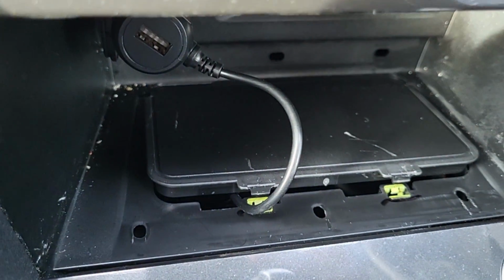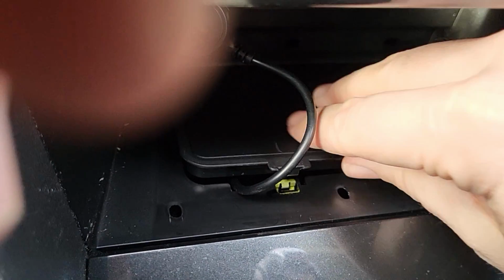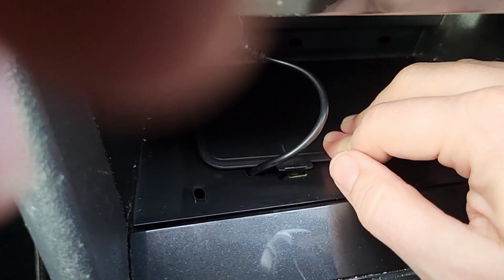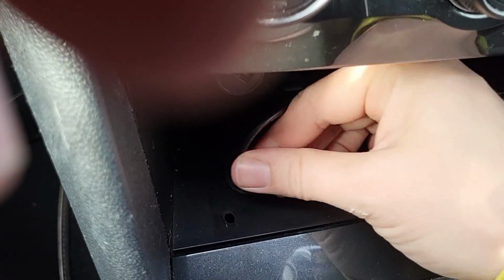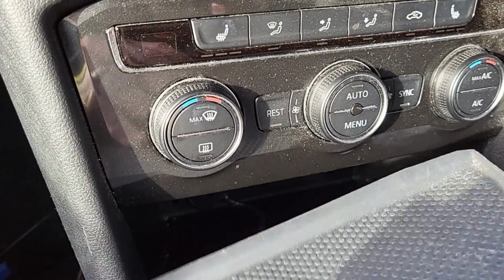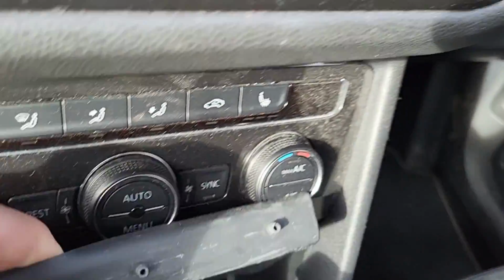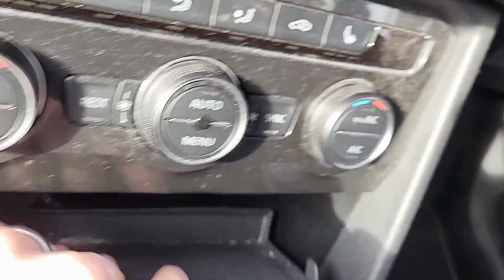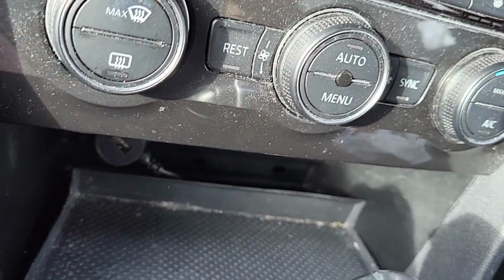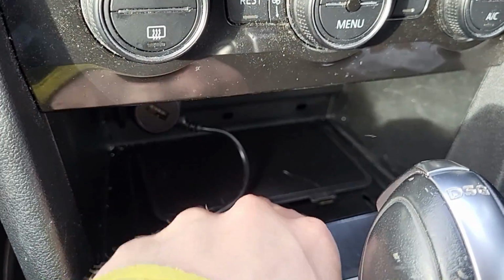right, so there you go. So there, the lead is sticking out. You should see there is a bit of a gap there at that front bit. Okay, and that's it. Leave yourself enough wire here so that when you put this bit back down into that hole there, turn that around like so, you're not pulling on the wire. Okay, so you might need to do some jiggery pokery to make sure that it's sticking out this bit, but you've left enough wire in which you can go around the back.